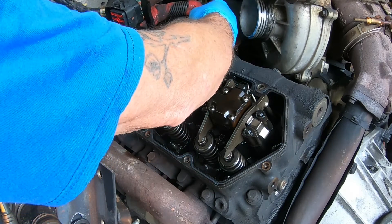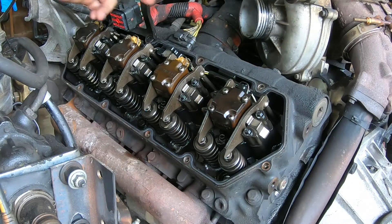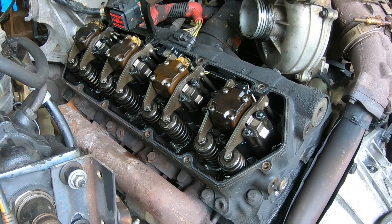I unplugged these all just to check the connections. The outside connection, no problem — you can always get to it. But that one there, it comes loose and you can't see it. I just want to make sure it's actually locked all the way in place. One more thing — I need to torque these bolts down to 20 foot-pounds, so 20 times 12 is 240 inch-pounds. That is beyond the range of this wrench, so I'm going to have to use my big torque wrench.